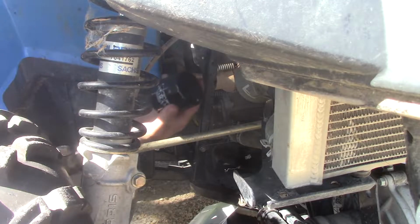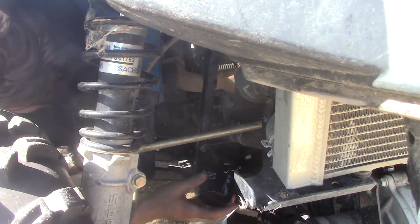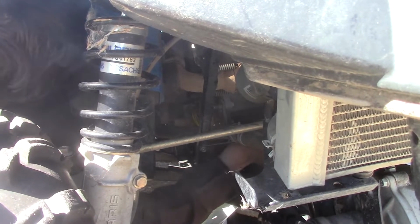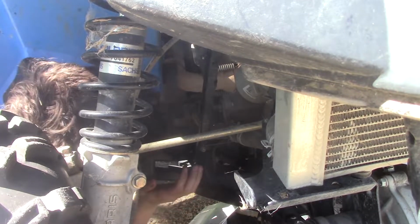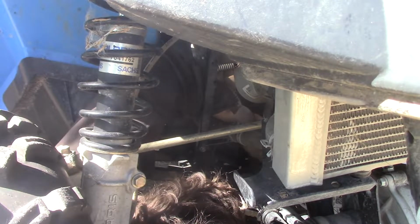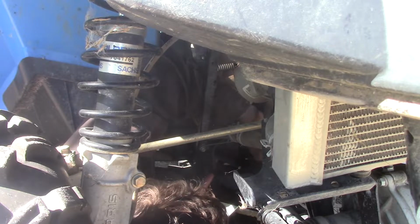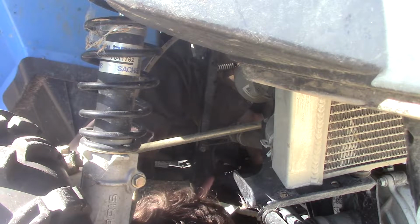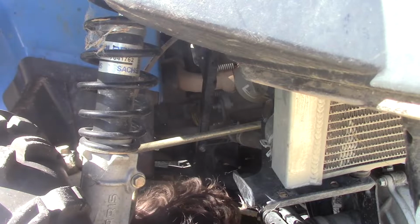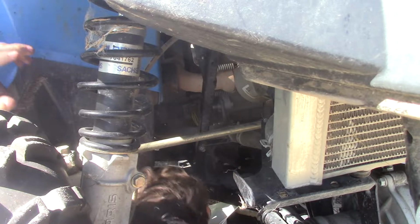It even says right here on the filter, 3/4 turn stop. So you don't want to over tighten this. Not like my last one was. So, let's get back in here. So nice turn, turn, turn. I actually have a little marker on mine to match up with the oil filter where I want it turned. Right there. Perfect. Oh, that was not hard at all. I don't get why whoever tightened that one on beforehand was a jerk.